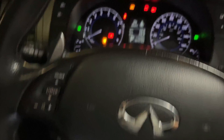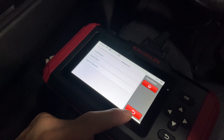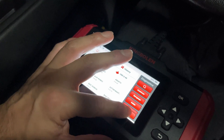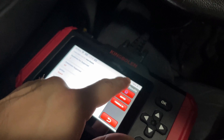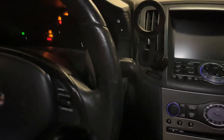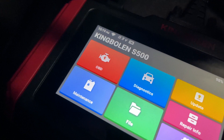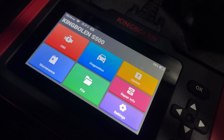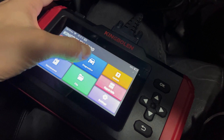I'm going to take you back through the menu so you guys can see. We're going to end the diagnostic session, go back, and check the OBD — it gives you a basic rundown. Now we're going to go back home and turn on the car. Here's a good flash — we were down to 9.2 volts and we're automatically up to 13.9, 14 volts. So you can see the battery reading is accurate. Now we're going to run our diagnosis with the motor running.